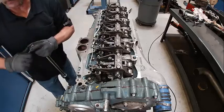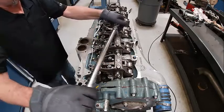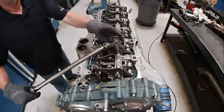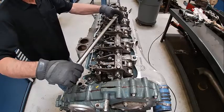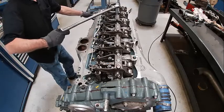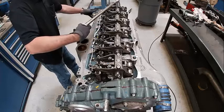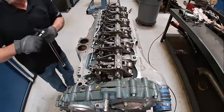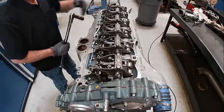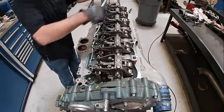The next thing I'll have to do is go through and set my valve lash. A little bit time consuming but it doesn't take too much. This one we may not have to adjust much just because nothing's really changed. Now on an engine with an in-block cam that can be different, because we can change the actual length — how far the valves are away from the head. But here where the camshaft's in the same exact spot, we really didn't move anything so it shouldn't change much. We'll see.